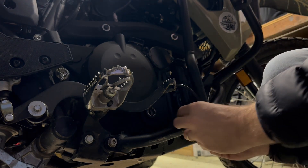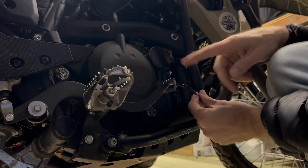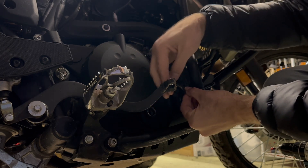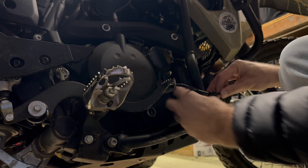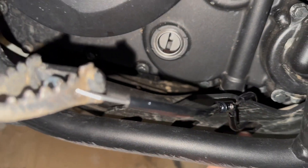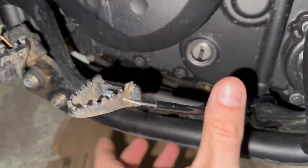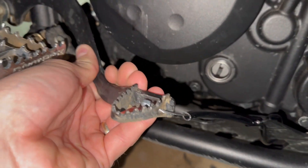It ends up being our U piece. Then it's just a matter of fiddling and working out where you want this bit to go. I ended up fitting it off the bash plate, mainly because you had a captive hole to keep it from sliding along here. You don't want it under here for getting hit if you roll it over — so here's about right. The brake can just do its little bit of movement in and out like normal, but if something comes along and hits here, it's just going to do that — it's not going to get wedged in. And if that tries to pull out, the brake can't pull out to bend this way.